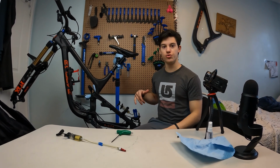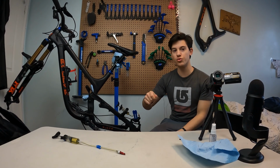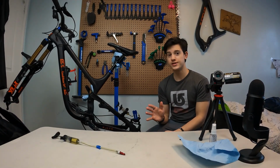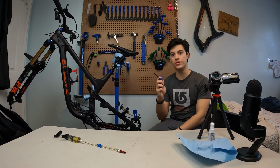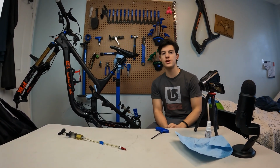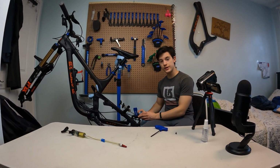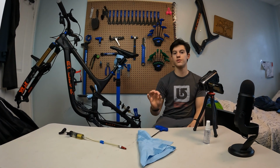Now we can pass to the bottom right here. So now double check that your system is closed, that you completely screwed that silver adapter, and so when it is, you can just pull that out and no oil will drip from there, because this is a really smart design. So just take that off and screw that a little more with your 4mm Allen key. That nut right there is also from 1.5 to 1.7 Newton meters, which is the same as on the lever, meaning that it's really low. Now take your rag and clean the inside a little bit. So this one seems nice, and now we can put back on our little plastic protective thing.